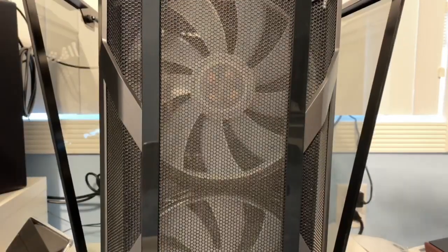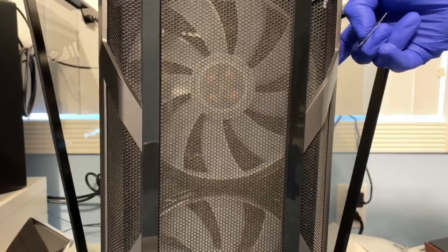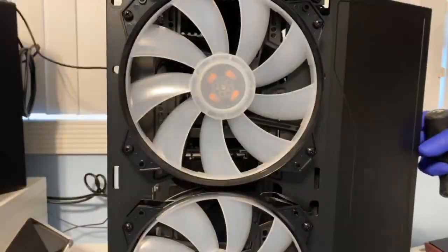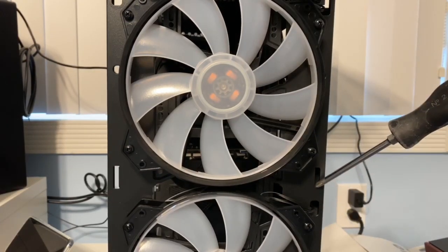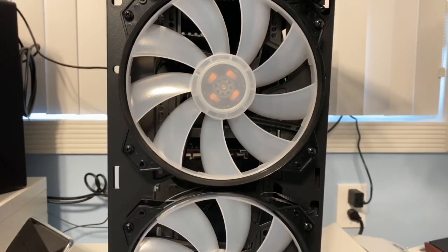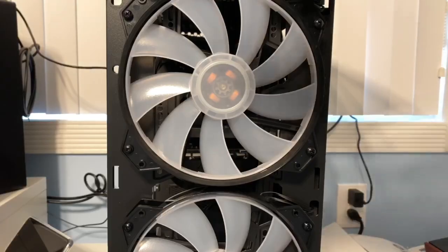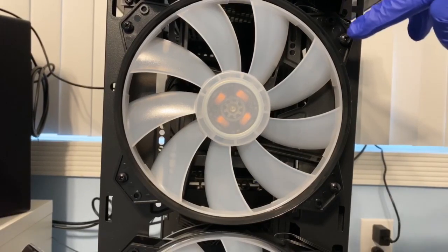All you got to do is take the two panels off on the sides, as you can see, these guys right here. There are clips on the inside that you just push in to pull them out — really easy to do. You basically have six tabs: one right here and another slot right there, and then on the other side you got one here, one here, and two on the bottom. All you do is just reach around the back, pull the tabs, bend them in a little bit, and then the front panel comes off. All you do is just bend these tabs in and this front panel comes right away. Once you do that, all you got to do is take the four screws out for each fan.